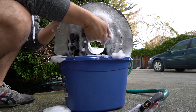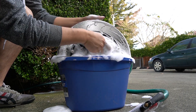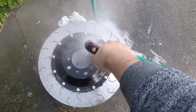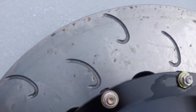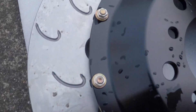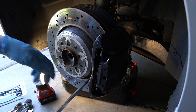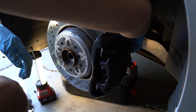Utilizing that, I'm going to dive straight into the installation. The first step is to clean the brake discs with dish soap. I'm not going to lie, it feels really weird doing this, but the whole purpose is to remove the rust inhibitors. As soon as you remove them, you will see the brake discs begin to rust, which is completely normal. All right, let's get to removing the caliper — first loosen the caliper pins.